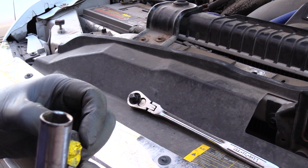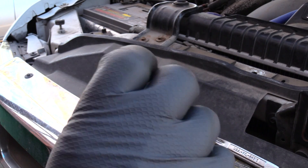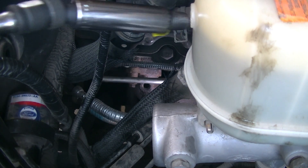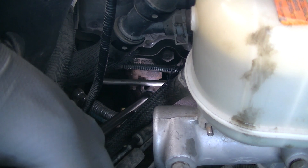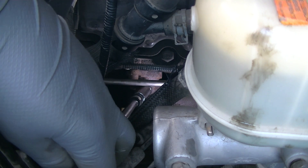To prevent the nipple from falling out of the socket when reaching down to the exhaust manifold, I put a small strip of electrical tape on the outside, allowing it to fit snugly in the socket. The most important feature of the swivel is that it stays put because it's spring-loaded from the inside — this was really helpful. It maintained the alignment of the pipe nipple with the exhaust manifold at the end of a long extension, and the spring-loaded impact swivel allowed the nipple to align with the threads, although I did reach down with the other hand to ensure it was straight.